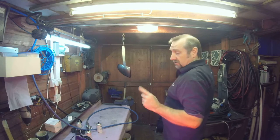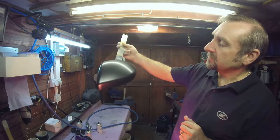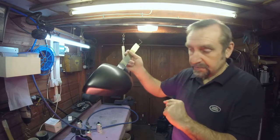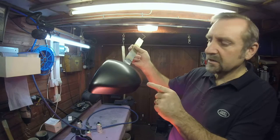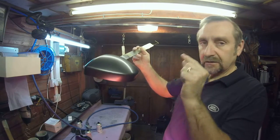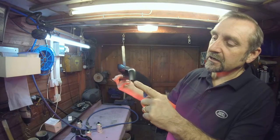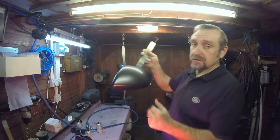As you can see, this is real time. We've only been a minute or so, and that is 95% a base coat finish already dried off. Also, can you see that's a very fine coat of paint? There's no film build on it at the moment, but we have no rubbing down marks. So obviously the P500 grit with the little orbit sander and the soft back marker pads to finish their edges does the trick. We don't get any lines, and that's only one coat of paint. We probably put two or three on there just to make sure we've got coverage.